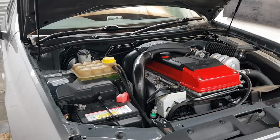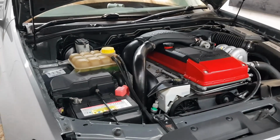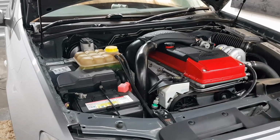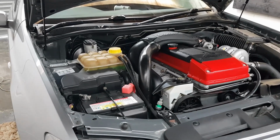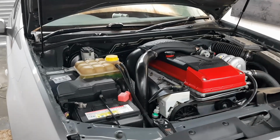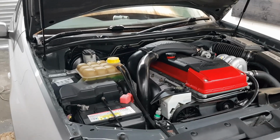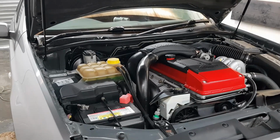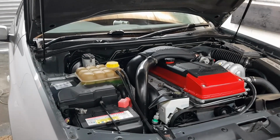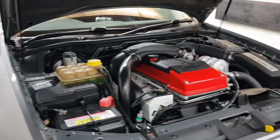So the ECU is constantly regulating that depending on what your throttle position is, etc. Now starting in the AU Falcons, in the back of that solenoid they put an adjustable grub screw, and that basically sets the base pressure of that solenoid. So if you wind that thing in, it means that now the base pressure runs higher, and then the ECU still adjusts the solenoid as normal, but the pressure throughout the whole range is higher. And what this causes is for the car to basically shift harder.